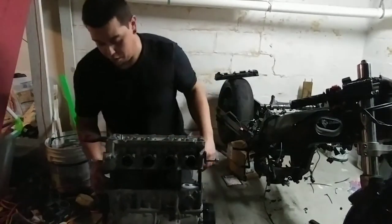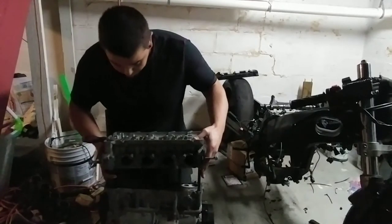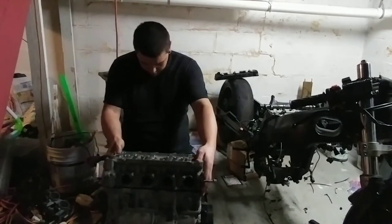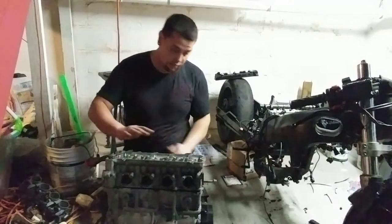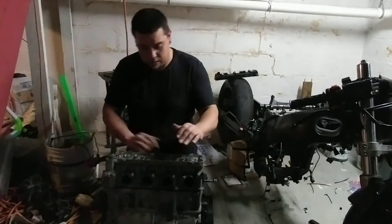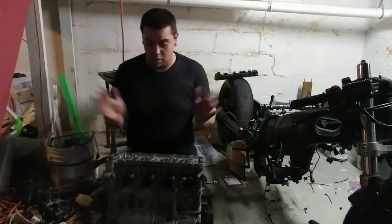Your adjuster over here — you can move it around. The thing that's going to hold you up the most is this adjuster right here, so you need to kind of squeeze it. Just let it slide down. That was way easier than I thought it was going to be. Leave the timing chain right there, don't mess with it. I'm going to try to get this to go down a little further onto the guide pins. There's one — okay, they're on.